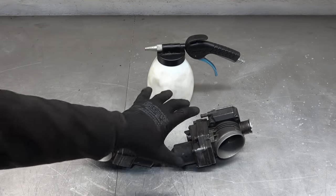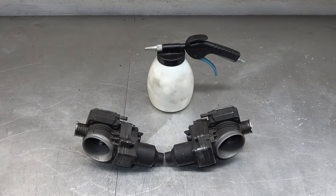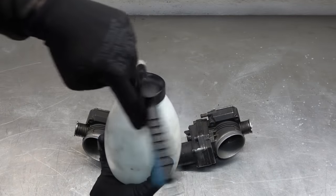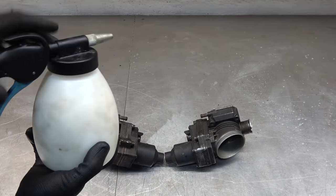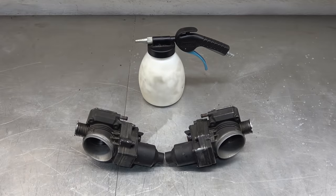The throttle bodies need to be opened up and cleaned on the inside. As you can see from the outside they also look rather disgusting and this isn't going to go well with our shiny intake manifolds. Since I can't put them in the vapor blasting cabinet because of water, we're going to use my small soda blasting setup from Hazard — around 100 euros, fill it with soda blasting media, hook it up to a compressor and start blasting. It's environmentally friendly — once you're done blasting you can rinse it off and it dissolves with water.